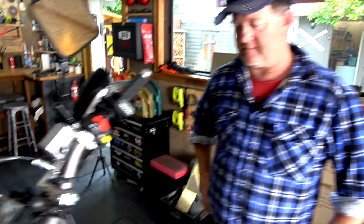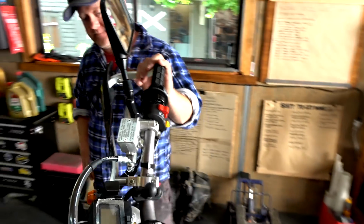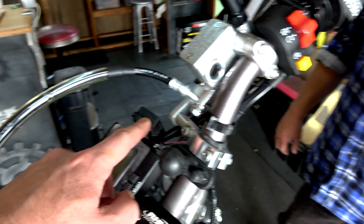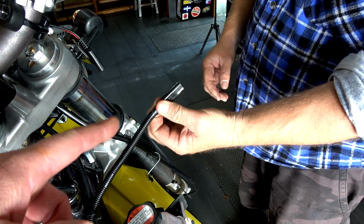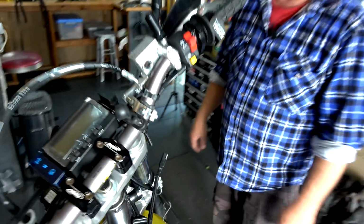So the only downfall to this is because we've got this tapped into the battery. That was the other thing, Chappy. We could have tapped that into an accessory wire instead of the battery. Oh yeah, one of those. Yeah, would have been an option. Why we're saying that, guys, is because this does not have a switch. So while this is connected to the battery at the moment, that little thing is slowly taking power out of the battery. If you're on a trip, overnight, couple of days without riding the bike, you don't have a problem. It's when it sits in the garage for a week, 2 weeks, it'll start to drain it. Yeah, but as I said, I like this because I can plug that into the compressor or a trickle charger. And when you come home and you pull up, you just got to remember to pull that apart so then it doesn't drain your battery.